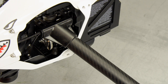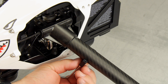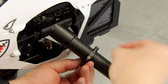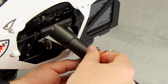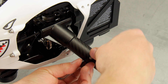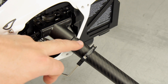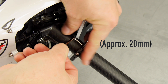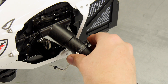The first step is to place the bottom bracket on the bottom of the Inspire 1 arm. You want to make sure that seats all the way. These screws have a split washer on them for security, so there is no mention of using Loctite or anything of that nature. You do only want to do these hand tight — you don't want to over tighten them initially because we may have to reposition these. Get the screws on there and get the bracket in position. The distance that this bracket should be away from the plastic arm is the width of the allen key, so if you slide this up until it's touching there, that is the approximate distance you should be away.